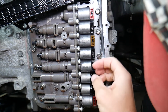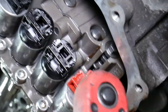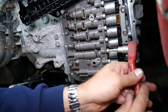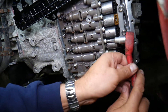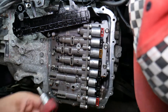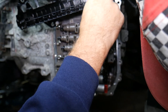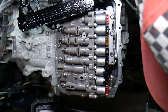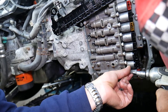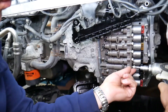You can't just pull the solenoids out — there's a locking plate that keeps all of them in place so they don't turn or come out. Each one has a tooth in the middle that holds it in place. You need to install that plate and align everything when reassembling. Pre-loosen the bolts in order, remove them, and you'll be ready to remove each solenoid. Note that this transmission specifically requires quite frequent oil changes.